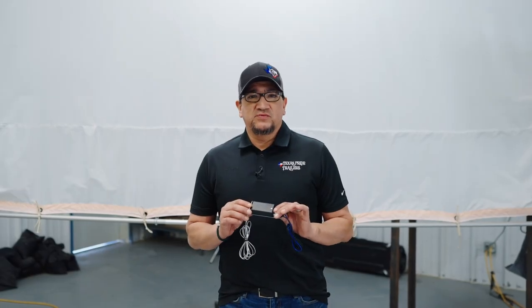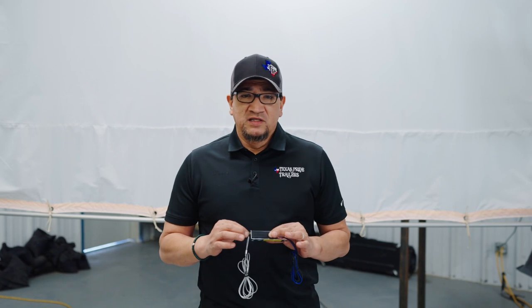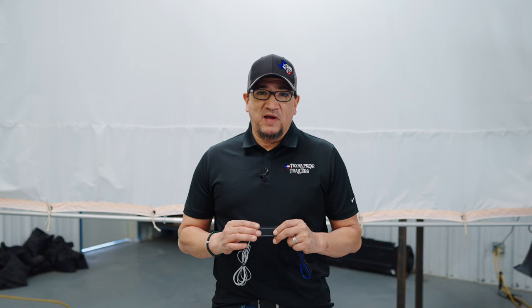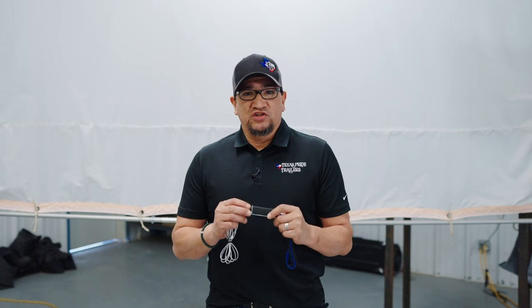One important note about the safety breakaway switch and its battery box: as soon as the pin is pulled, it starts using battery and continues to drain until the pin is pushed back in. Once your situation is under control, push that pin back in. Some people will park their trailers at night, unhook, and purposely pull the pin out for theft prevention — not realizing the battery will drain throughout the night. Next morning they hook up and plug the pin back in thinking the breakaway switch is working properly, when it's not. So never pull the pin out just for theft prevention, and always check the charge on your battery. It'll keep you and those around you safe on the highway.